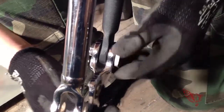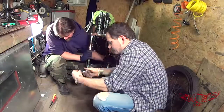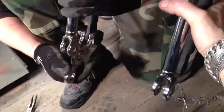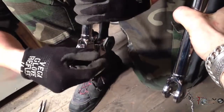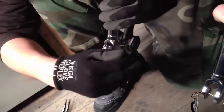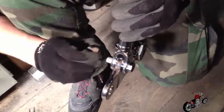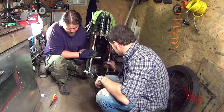bearing retainer, which is this big bolt that goes onto the rocker arm, and then by compressing and using the bolt washer and screw that we kept from this assembly, we drive it through the front ball bearing, we add the washer, and then we tie the bolt. Here is the first rocker arm, all nicely put together.